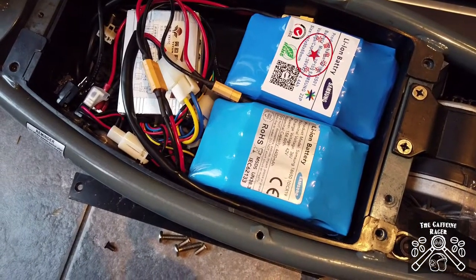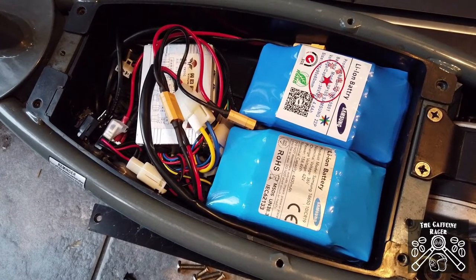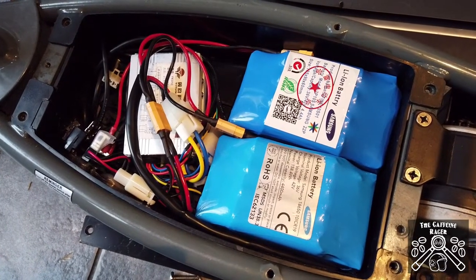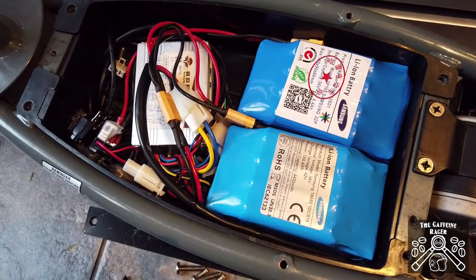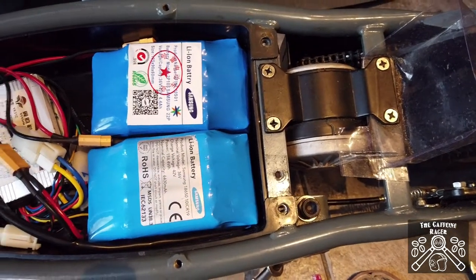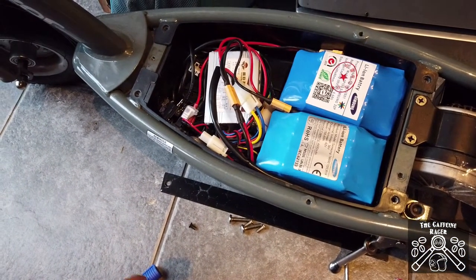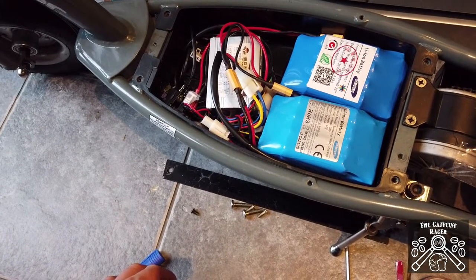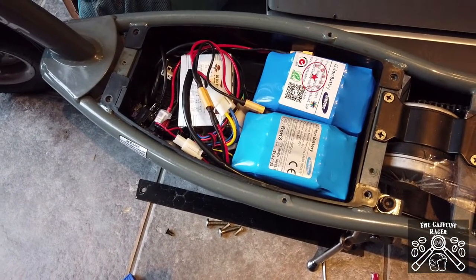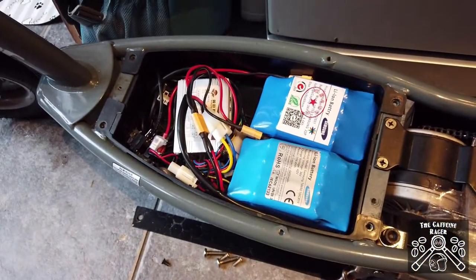The improvement in speed is quite good — going from 12 miles an hour with not much punch on the original lead acid 8 amp hour batteries, to 22 miles an hour that gets you there quite quickly. In future it will be going to an outrunner motor inspired by the Dicky Withers build. I'll put up a video about XT60 connectors and how to solder them in the easiest way I found — because of their size and the amount of heat they can take, they're quite difficult to solder, but as you can see I've managed to do a neat job.